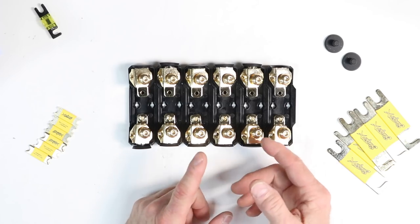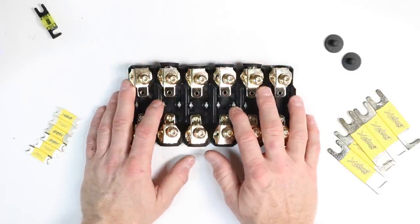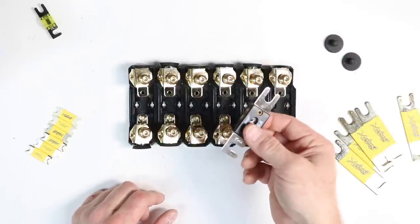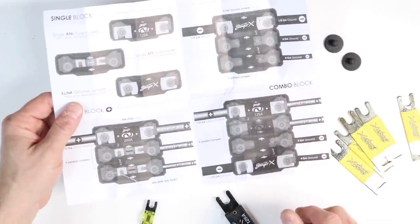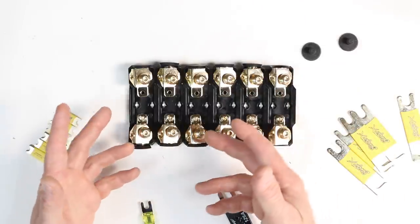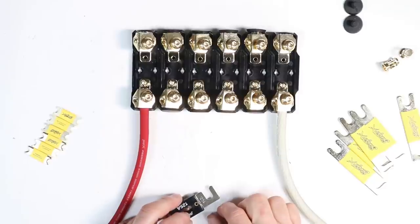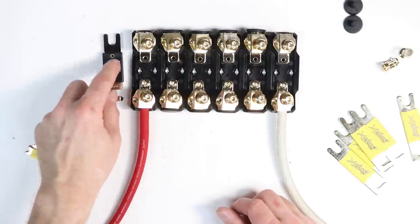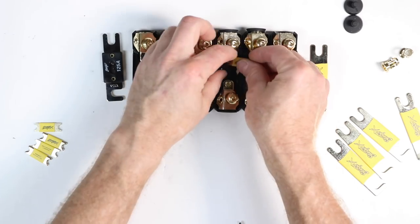This opens a whole new possibility for how you distribute power and fusing in the back of your car. If you want straight distribution with no fusing you can use the link connectors as-is; if you want fusing in the back you can use mini or full-size ANL fuses. They give you a bunch of examples on the included sheet. The rubber end caps are there so you can cap off unused wire ends, and you can easily remove them for the connections you are using.